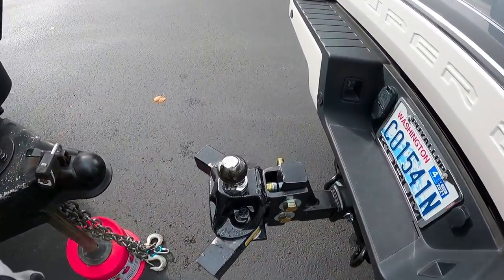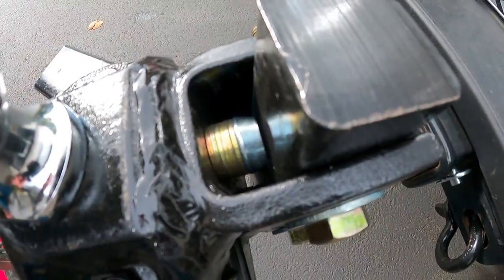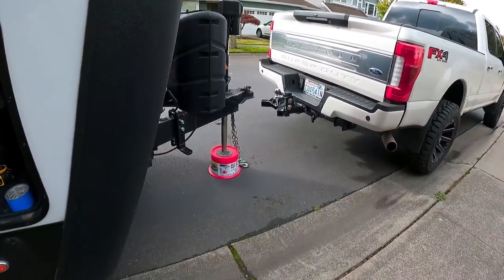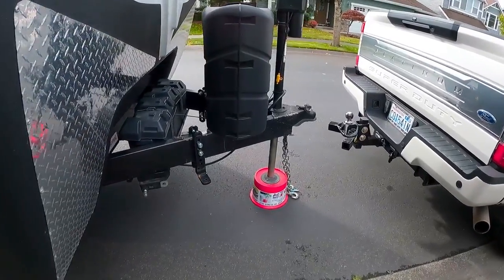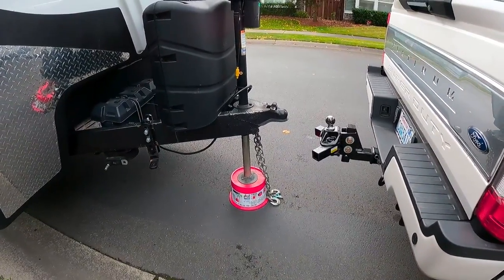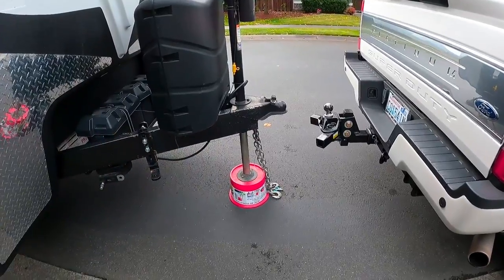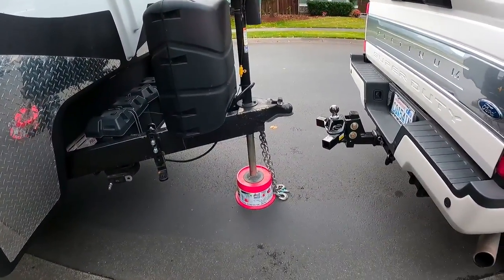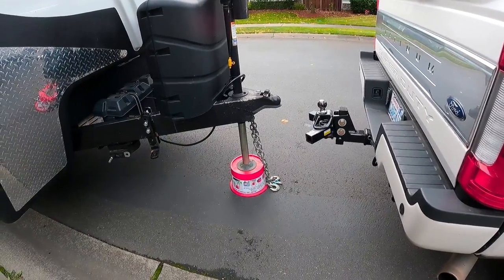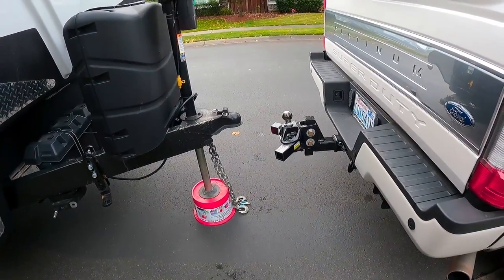As far as the hitch head setup, I made sure they put in six spacer washers in the middle and set the angle set bolt on the bottom. I wanted six spacer washers because we're running more than 90% of the hitch's recommended weight - 1,400 pounds. They suggest starting with six washers when exceeding the rated tongue weight. For normal trailers without heavy tongue weights, five spacer washers is the starting point. You can run no more than nine spacer washers - five to nine is the recommended range. We went with six and we'll see how that works with our full measurements and setup.